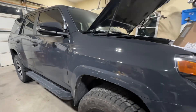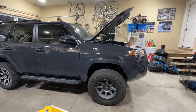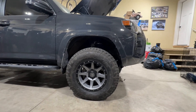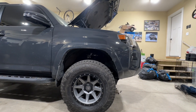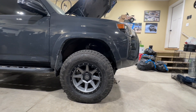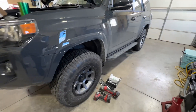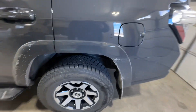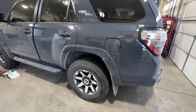All right, here we are with their 285 on the front and their Icon wheel. The suspension arms are still loose, so I need to go through and tighten the upper and lower A-arm bolts and then the lower strut bolt. And then we can move on to the rear. All right, we've got the front suspension bits all tightened up — time to move on to the rear.